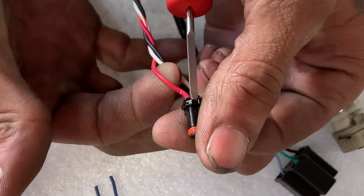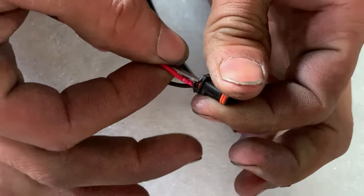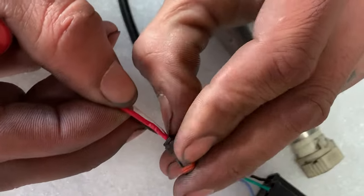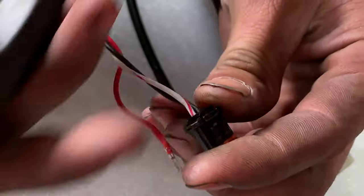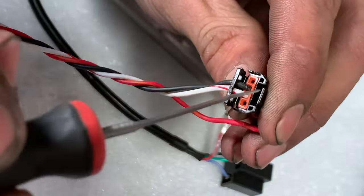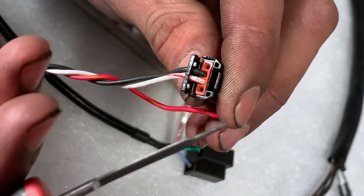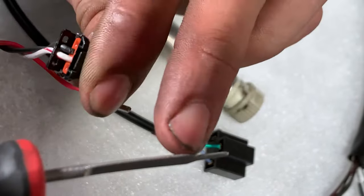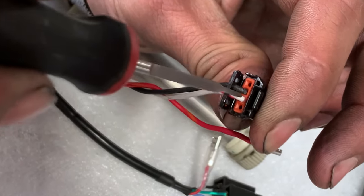That flat head tool in — and you'll push the little plastic ramp down. Same thing, we kind of want to put some pressure on the wire we're trying to take and the tool at the same time. So you're just going to line that wedge up and put the flat back side of the wedge up against the connector, with the tapering side toward the metal pin.